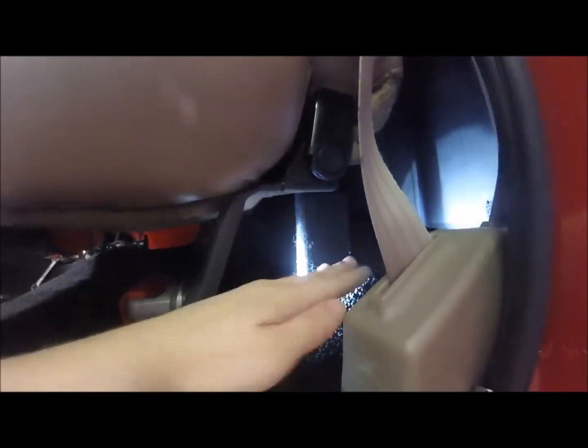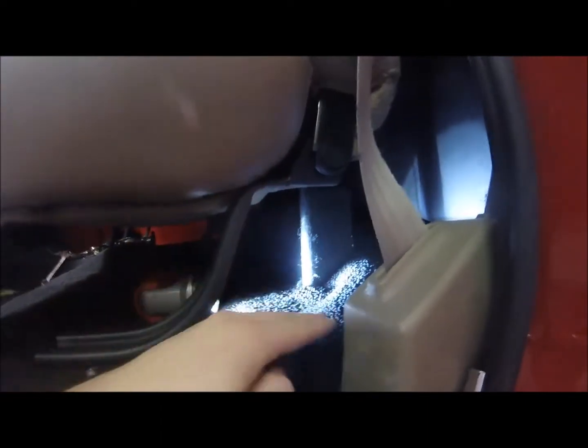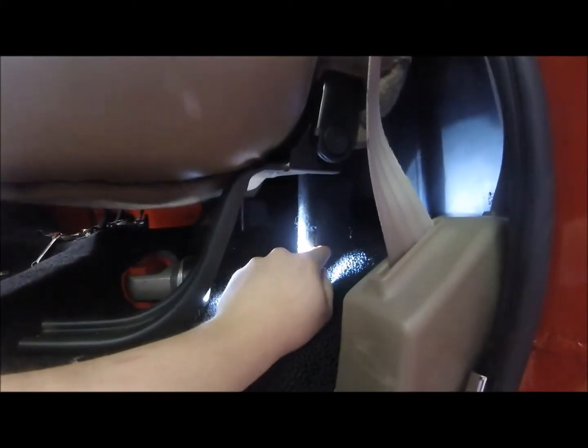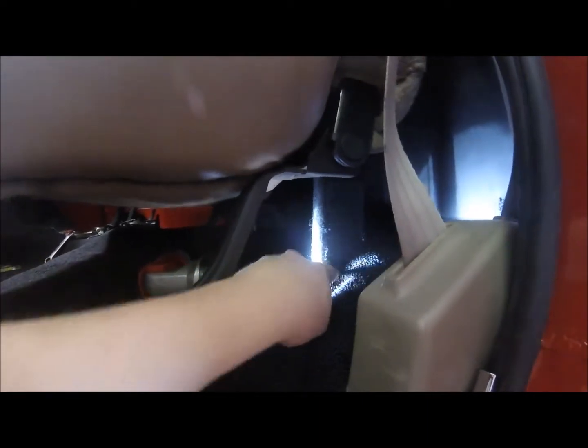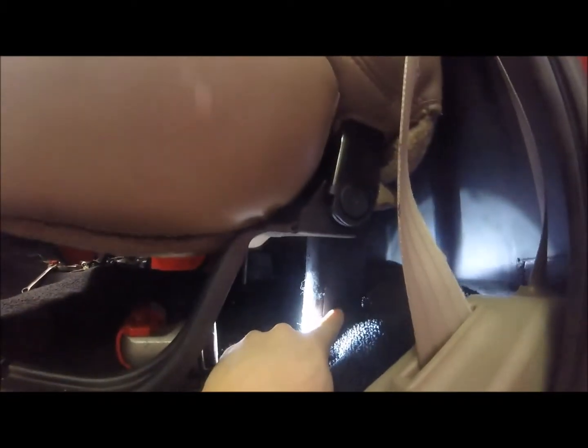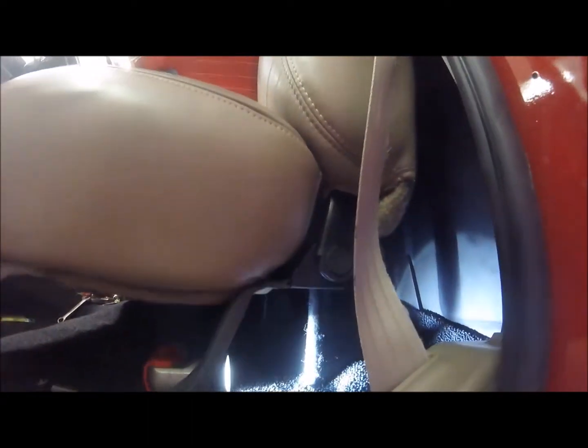And then to support the bolt again from this forward twisting motion, there's this plate here welded down to the floor, and I think that's 1/8 inch. Welded all down to the floor, welded all up to the pipe. That one right there, that middle one, is the exact same story. And then the one down there is the exact same story, except the 2 middle ones don't have a plate like this welded to them because there's 2 pipes next to each other. They have a plate that welds them both together.